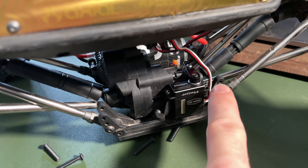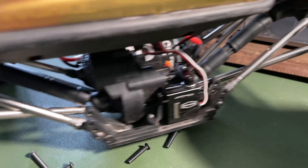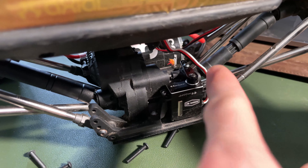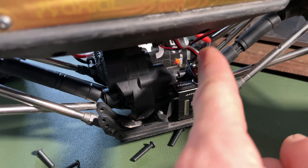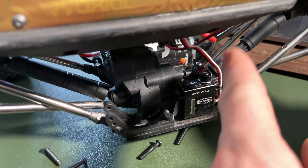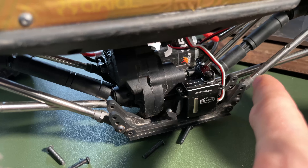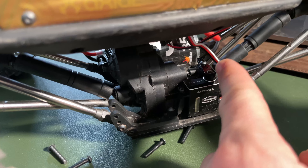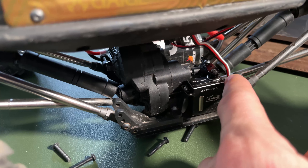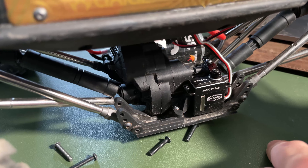Once all that's done, you just need to set endpoints and make sure the servo is centered well. All the way forward gives you full four-wheel capability. You can set a center position as neutral mode — a slight bit of right from center will put it into neutral, and there's a fairly large range you can use as your center point. You don't have to do that — you could just do a two-position setup with dig on and dig off. But you can also run a three-position setup with neutral in the middle, which is kind of cool. Just make sure you're not over-torquing when going into dig mode, because that will make the servo heat up.